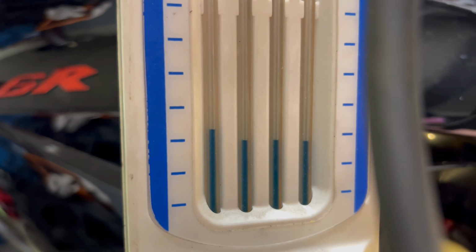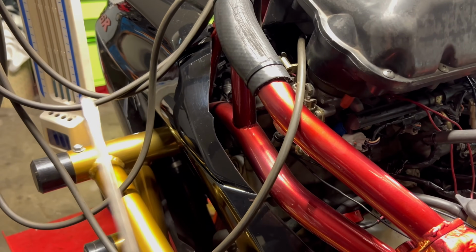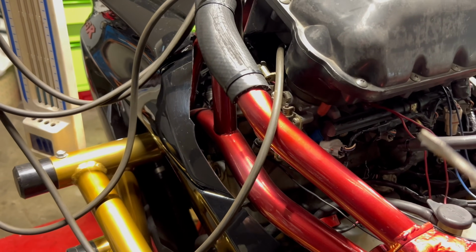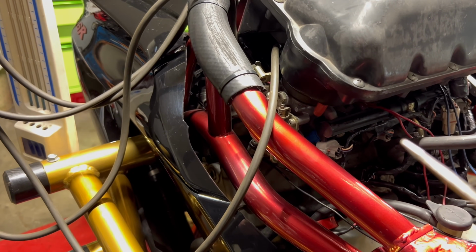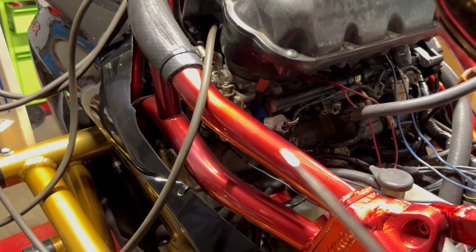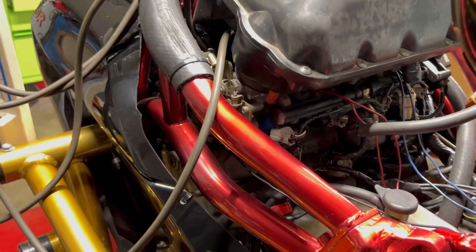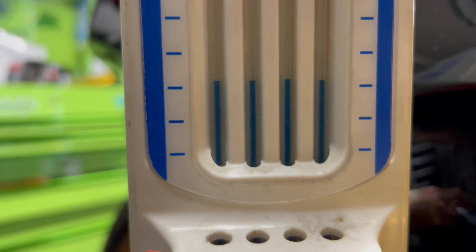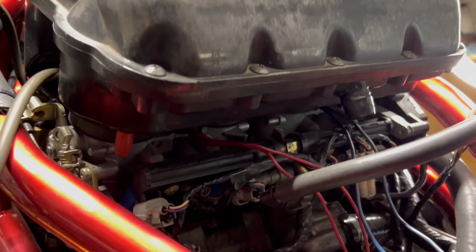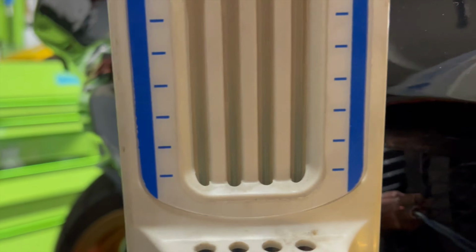It's not too bad. I can do a little bit of adjusting. And as you adjust those air fuel screws, you'll watch the throttle sync tool and it'll be moving every time you turn that screw. And you'll know you're going the right direction, or if you're not going the right direction, by turning that screw and watching that sync tool. But also, I'm not going to mess with the first cylinder. I'm going to sync 2, 3, and 4 all together to 1. It's hard to video this while I'm doing this at the same time, but I showed y'all that I got 2, 3, and 4 cylinders all synced to 1, and it was perfectly in line.